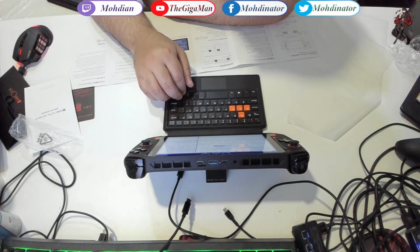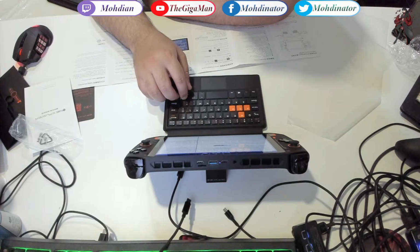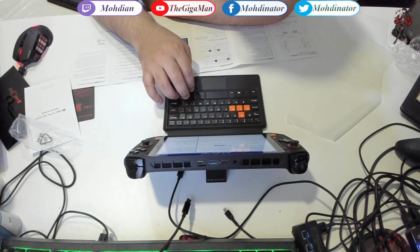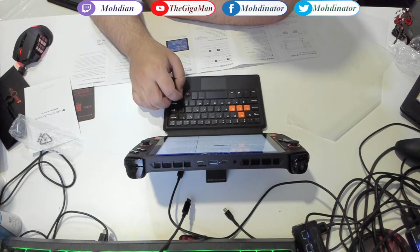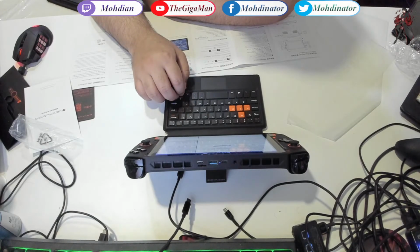Overclocking SKU. Value must be between max and min power limit specified by the package. This value must be between min power limit and TDP limit. Okay. Processor applies control policies such that the package power does not exceed this limit.